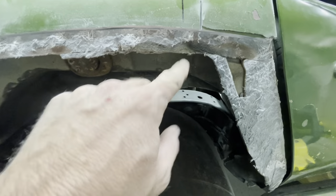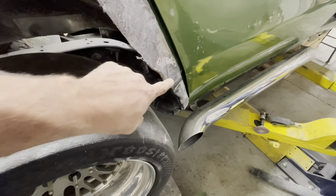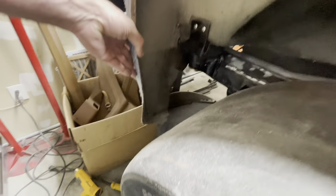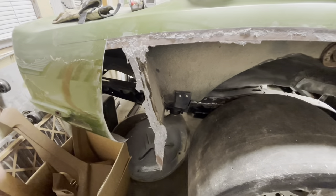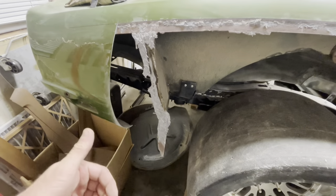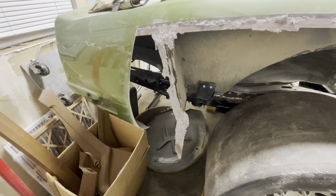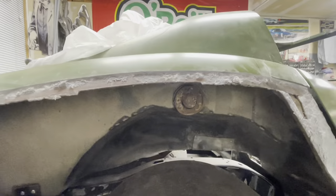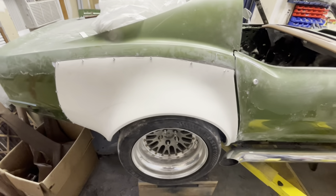You can see most of the fiberglass came off the binding strip. I didn't even put heat on this section - you can see I put a little heat here that transferred through the actual fender. This is all panel bond or whatever they used, so that'll all go down and get cleaned up. I'll have to put an extension on here. The good news is there's enough material on that fender to use or I can just come back with new mat. That's the inside of the fender - just another example of how bad the rust was.